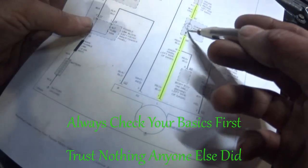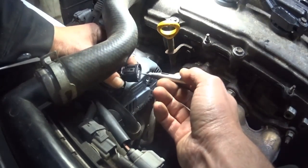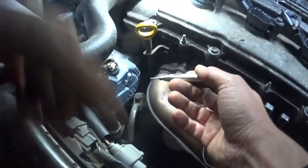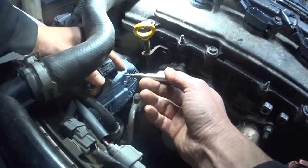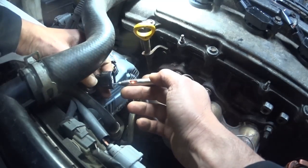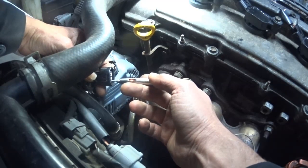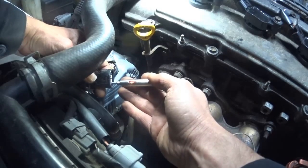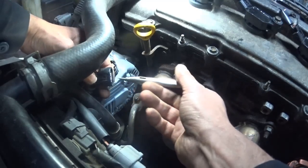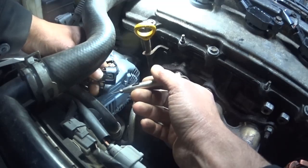Red and blue is the light circuit. This should light dim if the bulb is good. And as you can see, it does — it lights dim. That's because of the bulb being in the circuit and I'm grounding the bulb with the test light and essentially turning it on. That's why you're going to have a dim light there — that's correct. If I took you inside I could actually show you that it is turning the light on on the dashboard — the battery warning indicator.